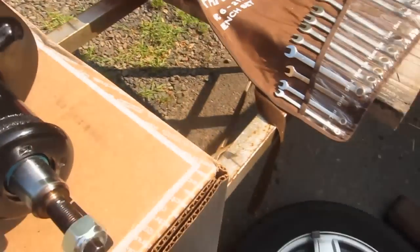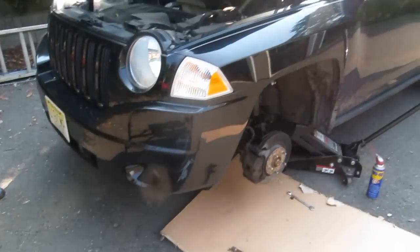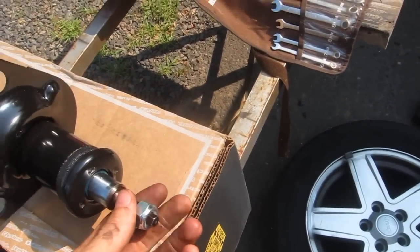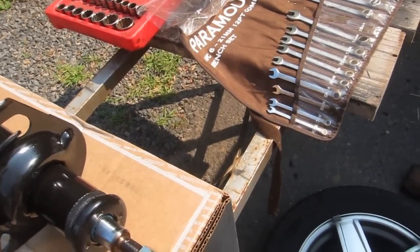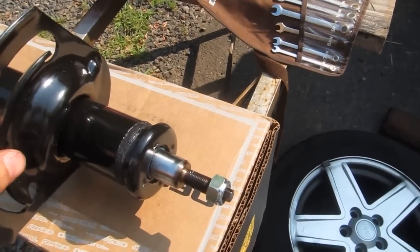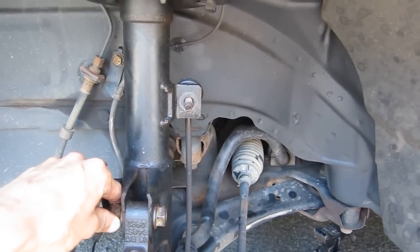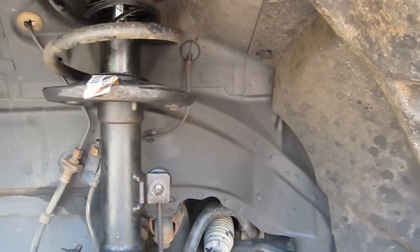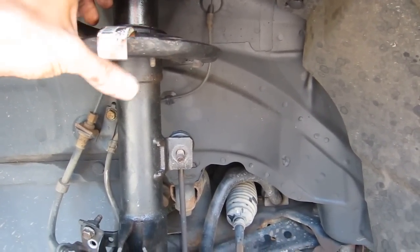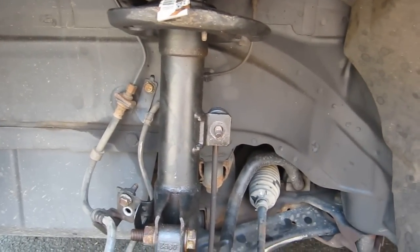Turning the nut will bring the two pieces together and you can press it until the spring weight is off the top of the nut, at which point you can undo the nut. That's the downside to doing this job — you can't really test the shock on the Compass until you get this nut off, and you can't get that nut off until you take the whole assembly out, compress the spring, and then push the shock up and down to see how easy it moves and if it retracts. As you can see, this new one is retracted — that's what they're supposed to do. They're supposed to be tough to pull in and out; if they're really easy, they're bad. I'm pretty confident mine is bad, so I'm going ahead with it. Maybe I'll make a second video. Hopefully this helps somebody. The other shock boot is ripped too — I'm guessing that shock isn't going to be far behind, but it's not leaking oil yet so I didn't bother changing it. Yeah, Jeep — thank you for ruining my day off again. We'll see how long it takes to get this one done.